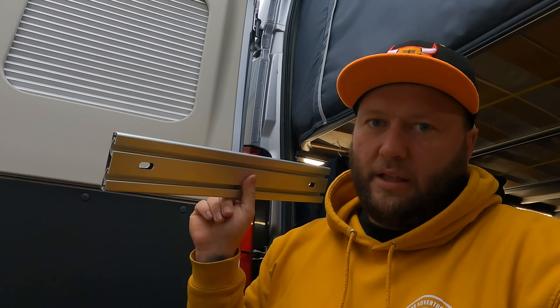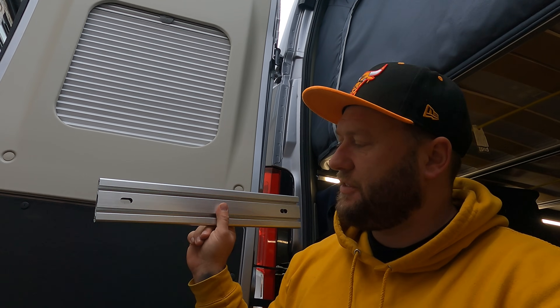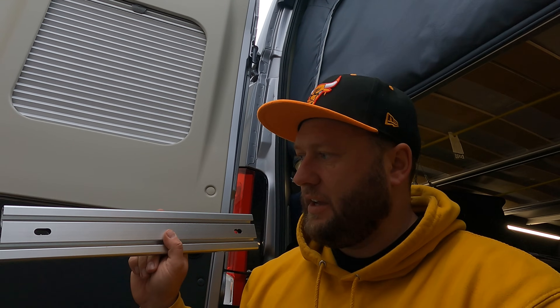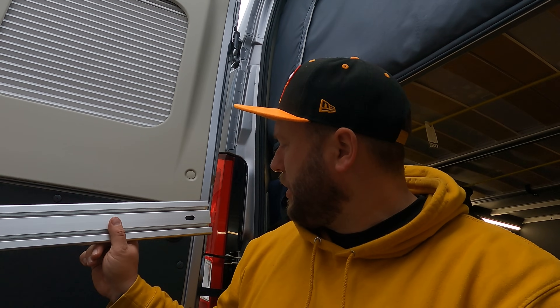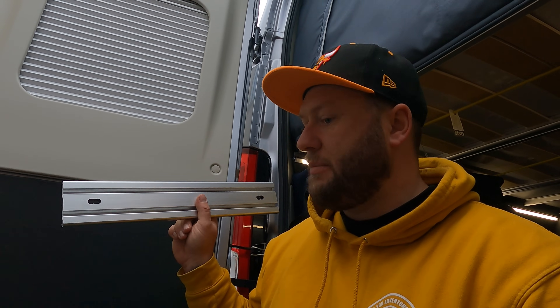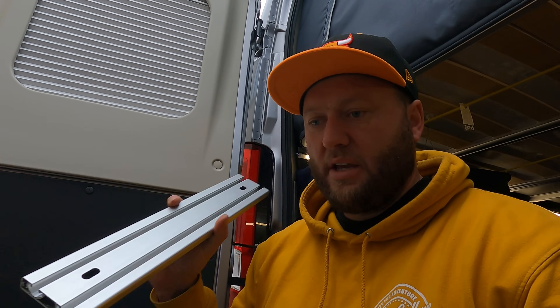When I ordered the mountain bike kit they come in lengths of 350 and 450mm — I needed 400mm to fit nicely in the tray, so I ordered the 450. I'm marking up a line coming in 25mm from either side, using the grinder to cut them off, trimming the burrs off and putting the end caps back on. That fits nicely to the width of the tray. I've done one, I'll cut this one too, and then get these fixed properly and get the bikes in. I've taken my time and it's looking really neat — like it's always been there.